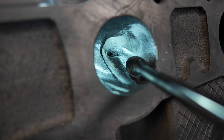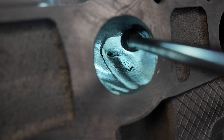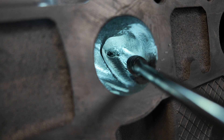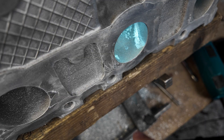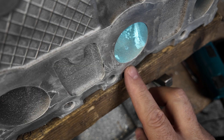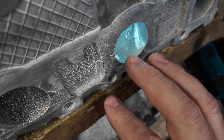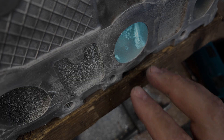Big sweeps are going to keep the shape. When we do the floor, it's going to be the same thing — we're going to sweep into it. Anytime you're touching that wall, big sweeps are going to keep that circle. I put a piece of wood so I can put a light underneath the head on the headstand — this is not for Hollywood. You really want to bring the work to you. A headstand and putting some wood to prop the cylinder head up so it's easier to work on is the best thing you can do, because this is all angles — the angle of your grinder and the angle of you doing the work counts too.